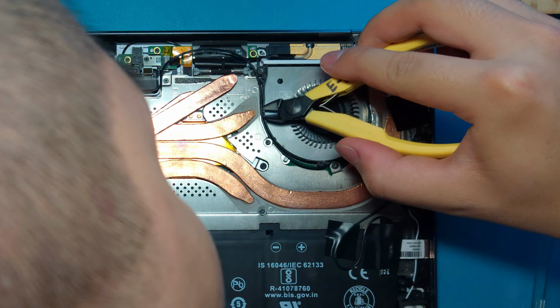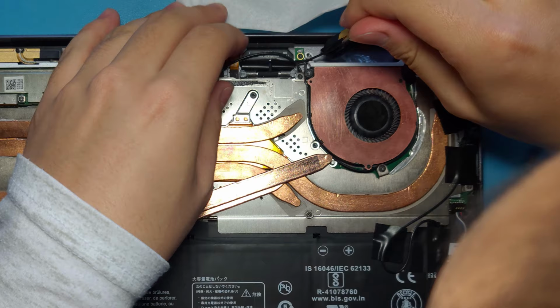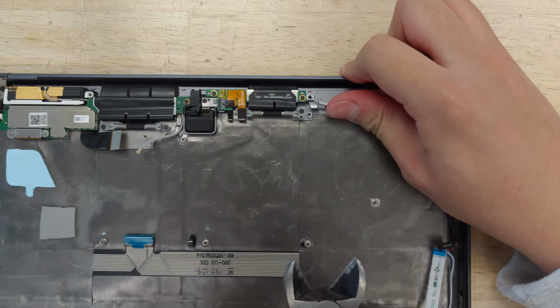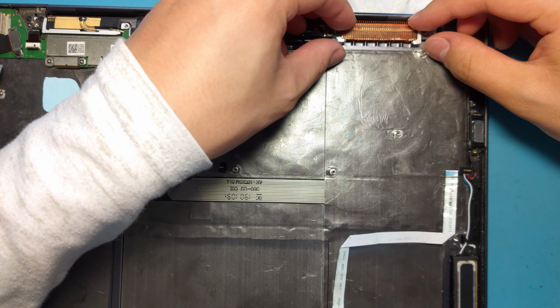We also need to snip off this one clip on the fan that's poking at the heat pipes. Now, the heat pipes can run without obstructions. With some tissue laid down to protect the surface, let's pry off the antenna that we don't need anymore. I cut off this bridge-looking thing that's part of the chassis to clear the path for both airflow and the heat pipes. I filed out the rough edges here and vacuumed the dust. The fin stack fits snug in the spot where the antenna used to be.